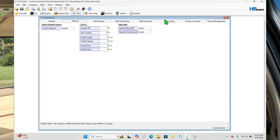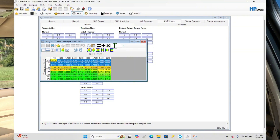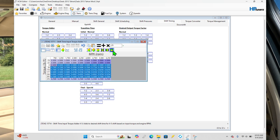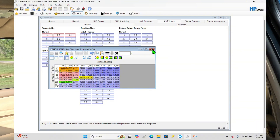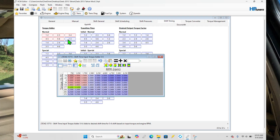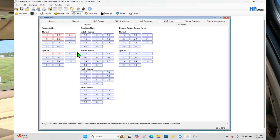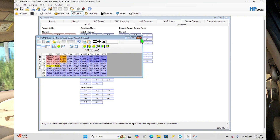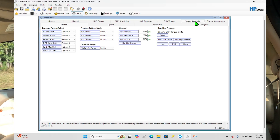The last change is going into the transmission to speed up the shift timing — the TCM's ability to shift the transmission quickly. We want to speed that up just a little bit, nothing crazy. In the lower reported torque areas we'll go with 0.45 or 0.5, and in the higher torque regions 0.2 or 0.25, blending in between. You only need to copy and paste these to your direct upshift tables — you don't need to do anything with the skip shifts or downshifts.